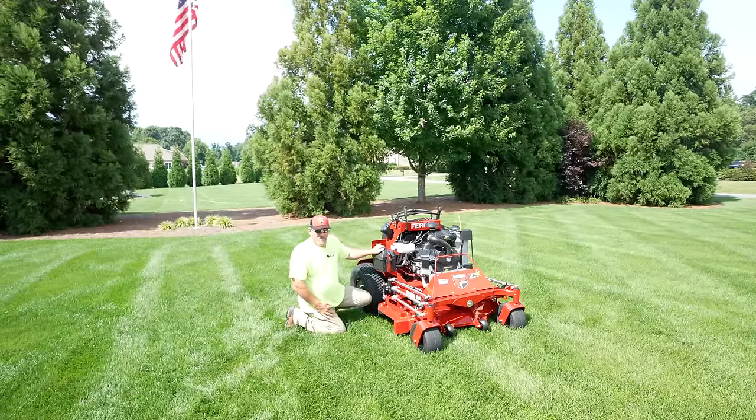There's a half inch drive. Is that half inch drive or 3/8 drive? It's one of the two, but you would take a pry bar with a half inch socket drive on it, square head drive, whatever you call it. You would put that up under there, and that would be what you use for leverage to pull this pulley back, and the belt just flops right off.